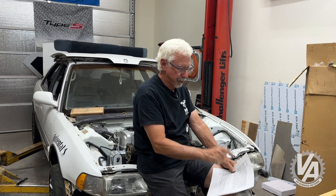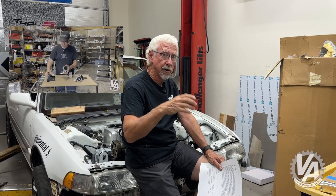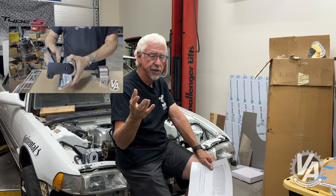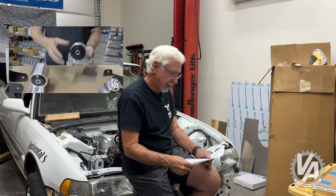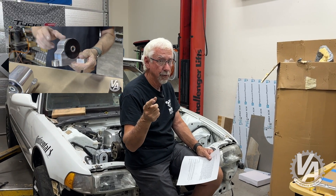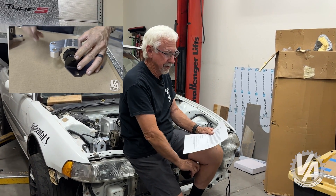So let's start off with the mounts. The mounts you want to use when you have a hybrid car are the ones that would be used for an RSX with an automatic transmission. For the passenger side mount, you're going to use a normal RSX engine mount and bracket. You'll need the RSX style bracket if you've got a K20, and the CR-V style bracket if you have a K24, which is what you have. You can also use Hasport's universal K-series block bracket for that as well.